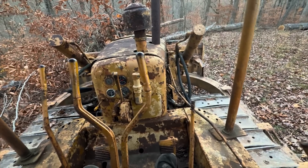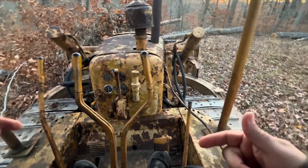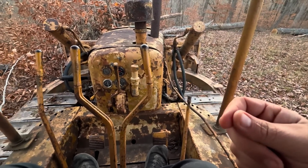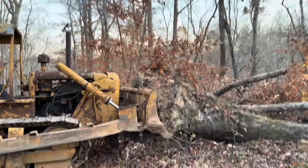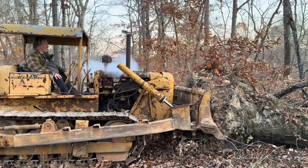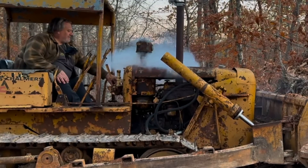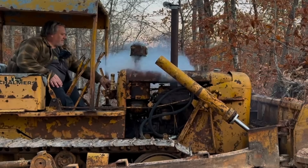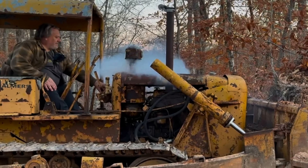I'm kind of curious why so much smoke was just coming out of the air intake. Was it running backwards? This engine can run backwards, and there was just a bunch of smoke coming out of the air intake after it almost died. I think it spun backwards. It definitely was running backwards there — when the engine died, the machine itself was rolling backwards just a hair as I disengaged the clutch. As soon as I disengaged the clutch, the engine was spinning backwards a little bit — just enough to free it up where it just started running backwards. It's possible on a two-stroke to do that — so that's crazy.